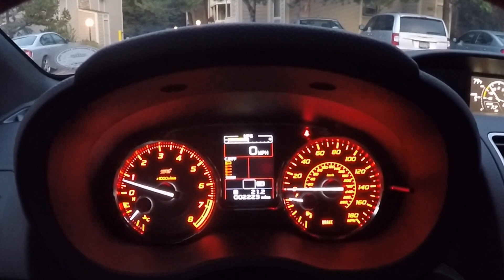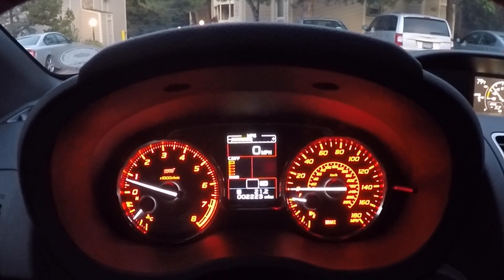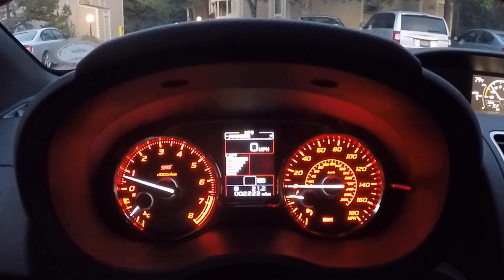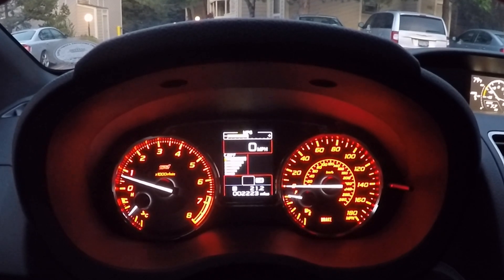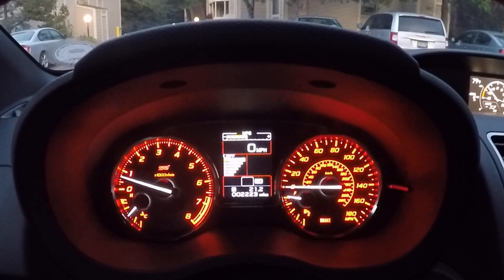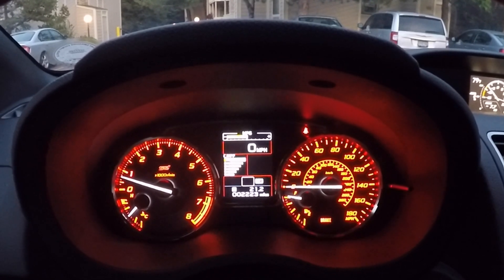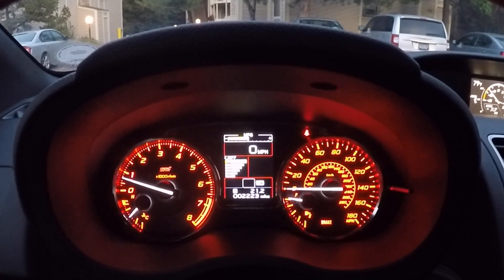Most people like that setting. I like to have that rear wheel drive bias, which is up to about 59% it can send to the back. The one thing you should never, ever, ever, ever do when you're on a dry surface with high traction: never go manual control and fully lock it where you can see 'lock' on your screen. Don't do that — bad idea. Do not drive hard with lock on on a dry, high-grip surface. This is for dirt, snow, gravel, something like that. Otherwise, you're going to tear up your drivetrain. Don't even go to lock.